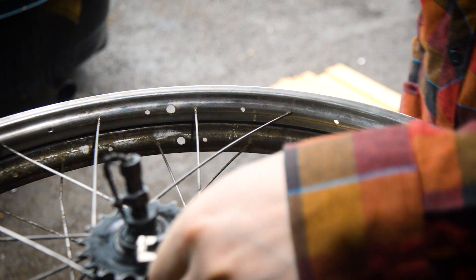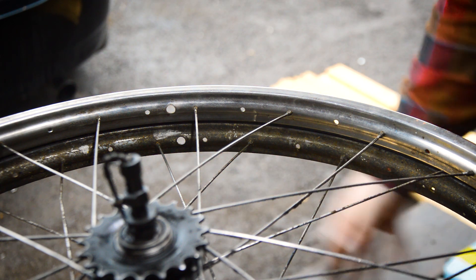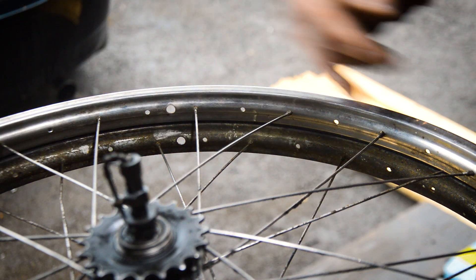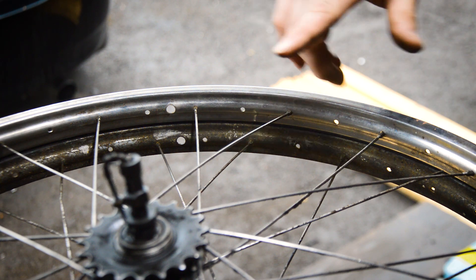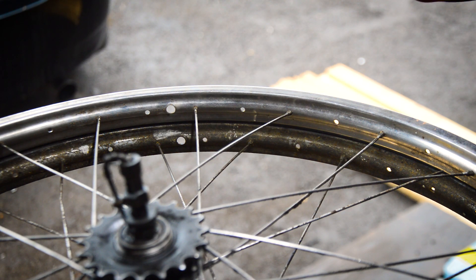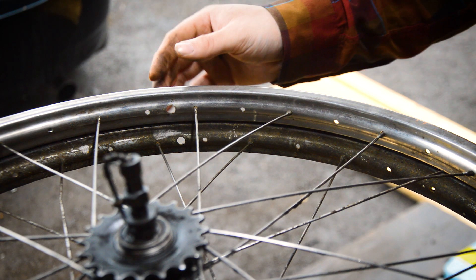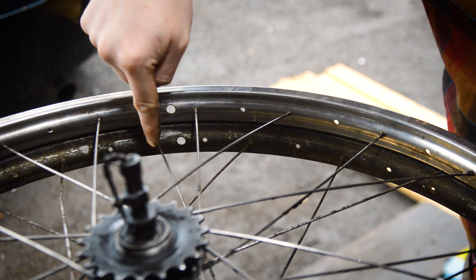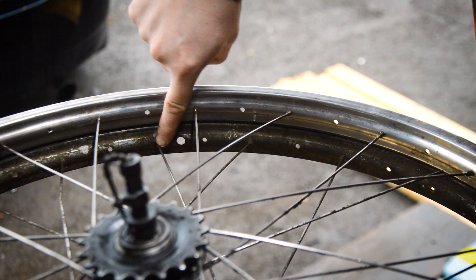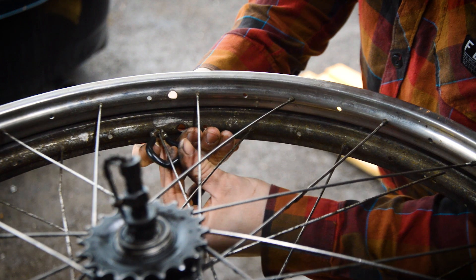That one side is done. Both sides of the rim are now floppy. I've got one spoke on this side that I need to replace — I can't get to it at the moment because of the cog; it's a threaded plug, so I'll have to do that when I service it. The other side has two broken or seized spokes, so this side is going to be the same. I'm just going to work one at a time — take that spoke out, put it in here, and eventually the bottom rim should drop away.